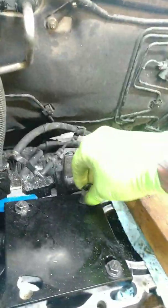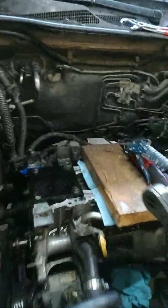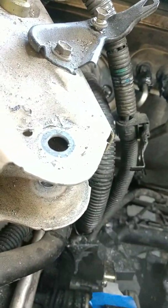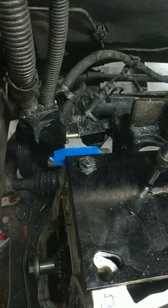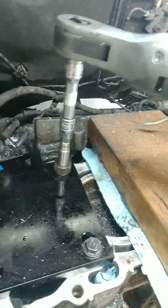Put the collar back in. It says to use WD-40 for the cutting, but I don't have any, so I've been using PB Blaster. Drop it in there, put a little squirt down in the hole to help with tapping. A lot of guys probably won't like this but this is how I do it. I've got a 12-point 7/16 socket that fits on this tap pretty good, and I actually use the electric ratchet because there are a lot of threads to cut by hand. You can see there's a mark right there on the tap — you want to go down to that mark and stop.